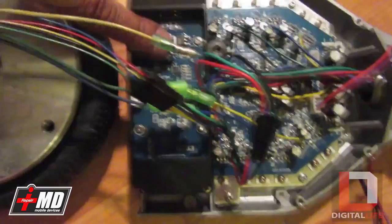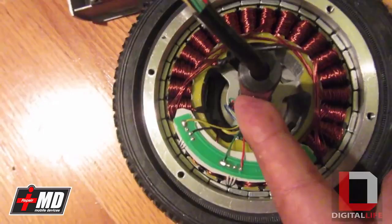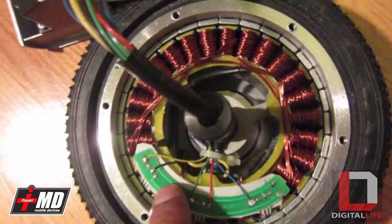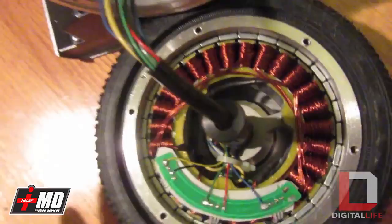It runs to this motor right here. I'm going to show you what the motor inside the wheel looks like. This is the actual electric motor. You can see this part right here is the one that's resting to the flat side, facing upward to where your foot is. And this is the vertical sensor. At all times, this is pretty much what you can call the balance, or the tilt sensor. This will always engage the top level right here. If it finds itself tilted down, it will turn off. This is how it's able to balance and always stay vertical so you won't tip off — that's the technology behind it. It's a pretty powerful electric motor. You've got the bearings right here, and it tucks into place where you apply the screw to it.